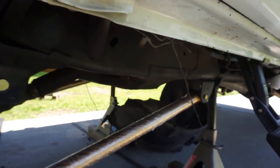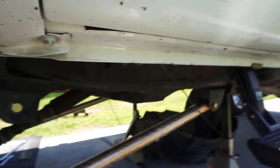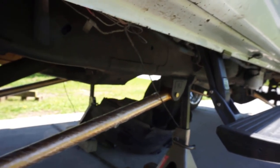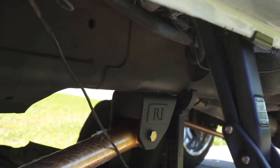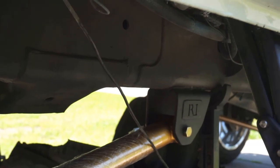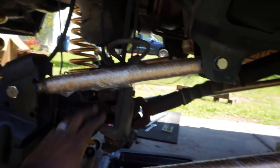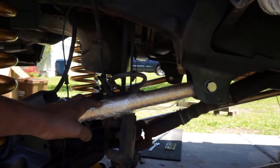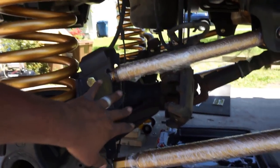So we had a little bump in the road with the long arms. The upper long arms were good in terms of length. But when we put the long arms on the lower ones, the bracket, this is my fault because I told Kevin where to weld it. I told him where to weld it right there. Should have pushed it up a little forward. I was talking to Kevin Ranette, who I got the equipment and all those parts from, and he was telling me afterward you should put the short arms on first, then the long arms. The reason being is your short arms are going to establish that initial spacing for the axle, and then your long arms are just going to support it.